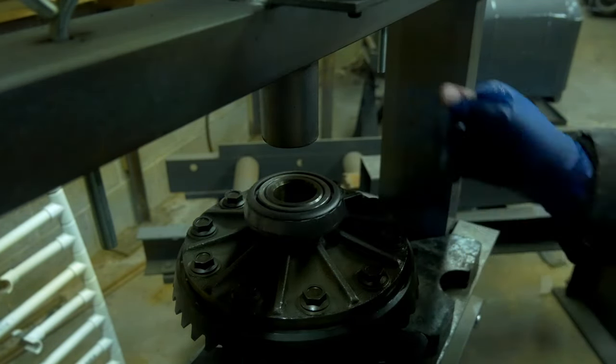So if there's any kind of a little piece of grit or grease that you left in there, that can and will throw off your measurements. So what we're going to do initially, especially with the original gear set, is I'm going to put these shims in incorrectly. I'm going to put the thicker shims, so that 8 mil and the 2.45 mil on the right side, okay? These shims fit in between the outside of the race and the case. So you'll see me driving those in here later on, but I'm going to put the 8 mil and the 2.45 mil on the right side, which leaves me the 2.25 mil on the left side.